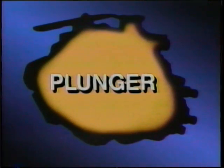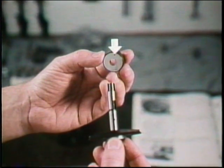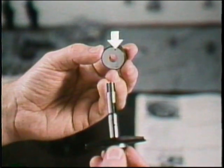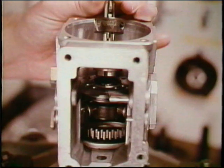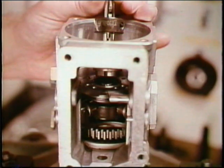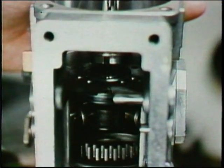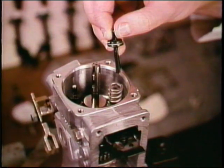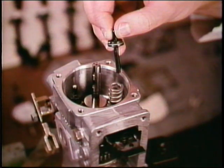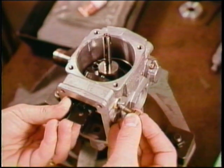Plunger. To put in the metering sleeve, you'll have to remove the plunger assembly from the head. Notice that small hole in the metering sleeve — it should always face the plunger foot. Now lower the plunger assembly with the spacer, thrust washer, and spring seat onto the cam plate. Line up the drive pin with the slot in the plunger foot and be sure the pre-stroke shim is in place. Next, place return springs and the guide pins with spring seats and shims onto the lower spring seat. When you install the governor lever assembly, the ball stud fits into the metering sleeve socket. Install the governor support screws with their gaskets.